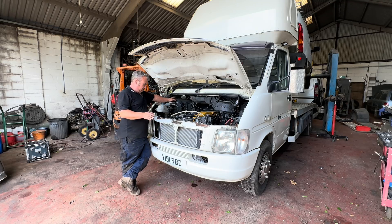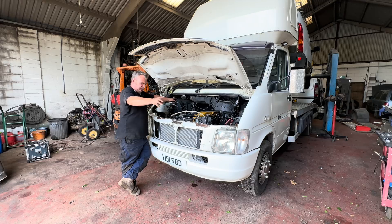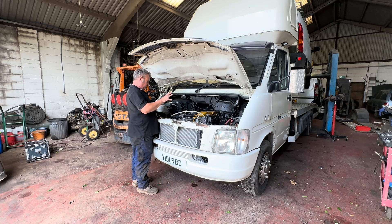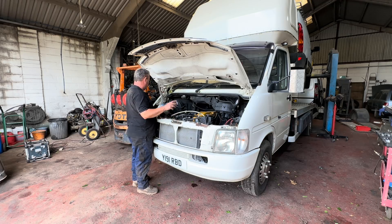So what I've now got to do is refine this, obviously make it a bit nicer, link up the quick spool valve, make the pipes for the quick spool valve, cooling doofer, make some boosty pipes, find an intercooler, and send it off to have an exhaust made. Without driving it there, because if we're trying to drive it to have an exhaust made, it's going to set fire to the bulkhead. So I'm going to leave this one here today - basically it's now running, so it's moveable, and the turbocharger is fitted.